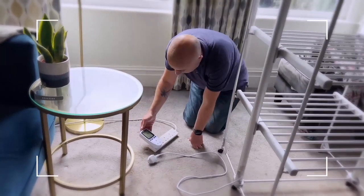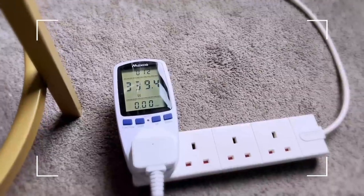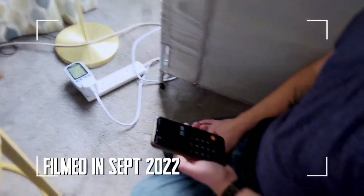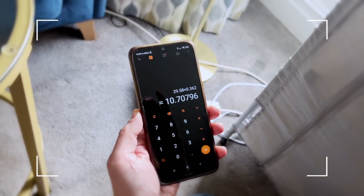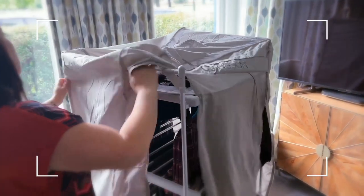We've been given this electric monitoring plug to see how much energy it uses. It does claim on the box that it's 6p an hour, so I'll be keen to see if that's true. It's got a timer on the top there, so that's good. It's been an hour, so let's see how much power we used: 0.361 kilowatts. We checked our tariff on the internet — we're on 29.58p per kilowatt hour. So that works out at about 10.7p, which is closer to double the quoted price. But the prices have gone up, and I don't know when those claims were made. I liked having it all in one place rather than all over the radiators and banisters — that was an improvement. It's definitely not as fast as the radiator though.